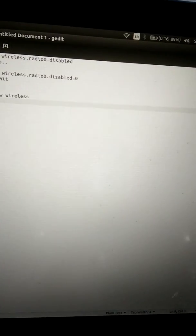If it works on your device, which is great, you can thereafter go to your browser, and just as you used to do routerlogin.com in earlier instances, you would hereafter log into 192.168.1.1, and then you will be prompted to set up a user account, and then you will be good from there.